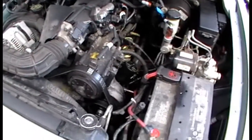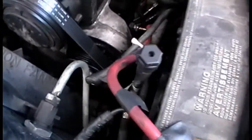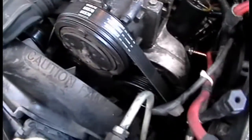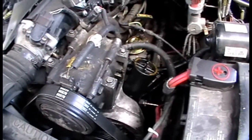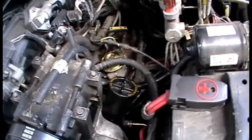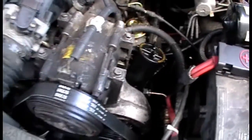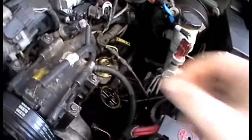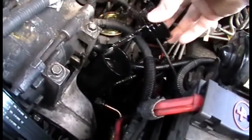It's been about 600 miles since I changed the power steering pump, and we're going to go ahead and take most of the fluid out and put some fresh fluid in. On this model you can use automatic transmission fluid — just regular stuff — and it'll be good to go. You can do this with a Ford Expedition, probably an Excursion, an F-150, and a few others. Just check with other manufacturers like Honda — some are usually different. This one works with ATF.